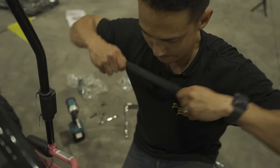On the Trailmaster Mini models, it is actually run by two chains. There's another chain underneath the plastic cover. In order to adjust that chain, loosen your engine's four mounting bolts — the engine mount is slotted so you can push the engine forward or back, and that will also adjust your chain tension.